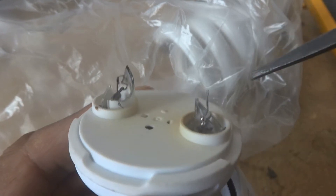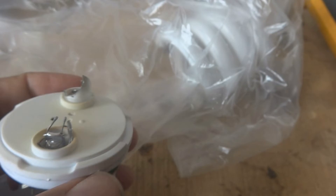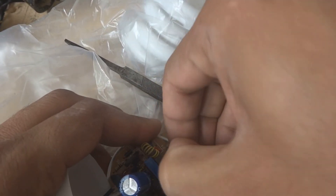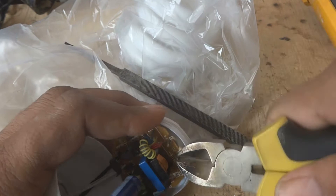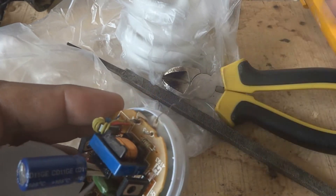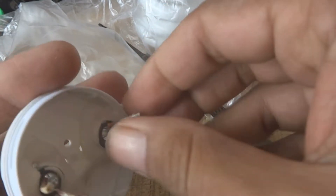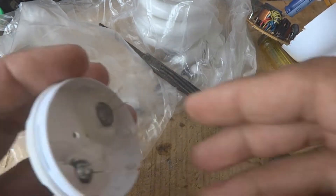This filament had been fused - that was the problem. Now we will remove the cables. We need to remove the PCB circuit board from the plastic part using a nose plier or similar tool. These wires are just wrapped on the pins, so we unwrap them and remove them. Remove all four wires - some off-camera. Now the circuit has been removed.